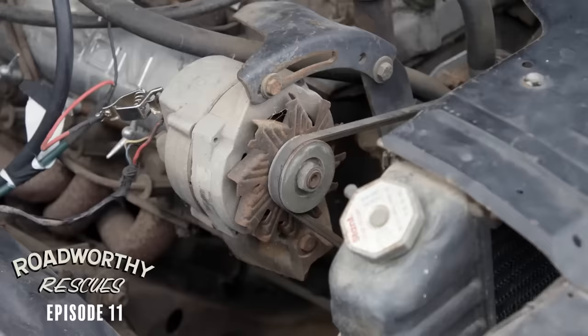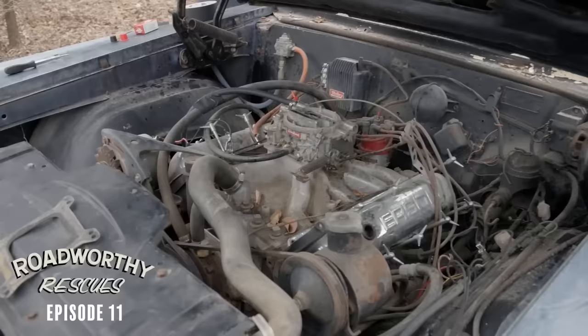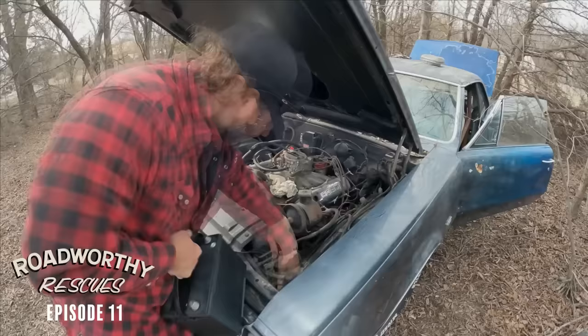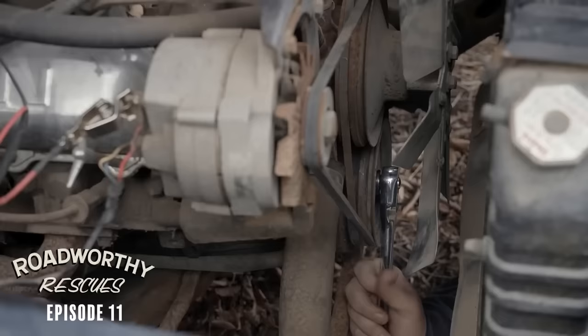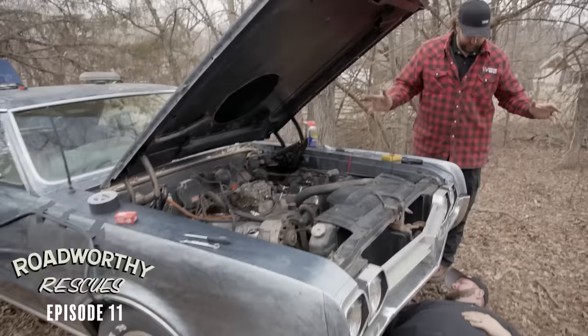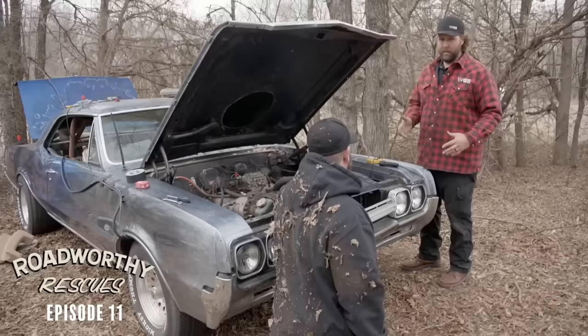The battery is plenty fine. That didn't seem to work — this might be really bad. Why else would they park a beautiful car like this? We've got a very prominent knocking sound coming from the engine — it's like a cabin screen door, it's loud. Now it won't spin over at all. We've got a wrench on the crank — yeah, she's tight. What if we pull all the spark plugs out and then try to spin it over to get some lube in there? Because if it's still tight, we know it's not compression — it's mechanical interference somewhere. Okay, plan.